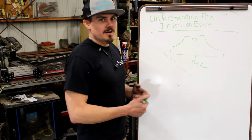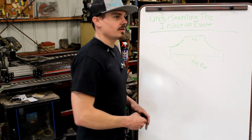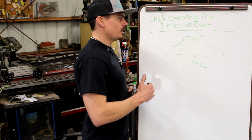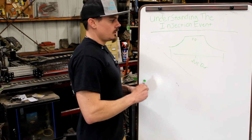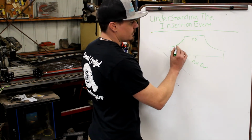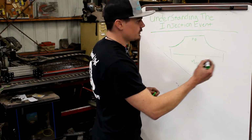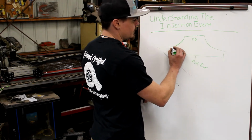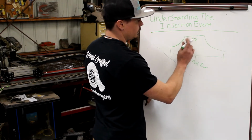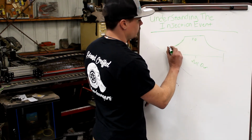And you know that you have volume through the system if you have pressure with an appropriately sized line. So we know they have a limitation. What we'll see is when we put too big of an injector in. So we know the pump's the same. We change out the injectors, and what we will see is the fuel quantity will go up. So let's say we drew this. So torque goes up. Torque and horsepower will go up